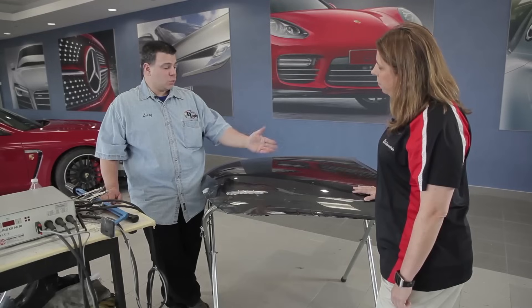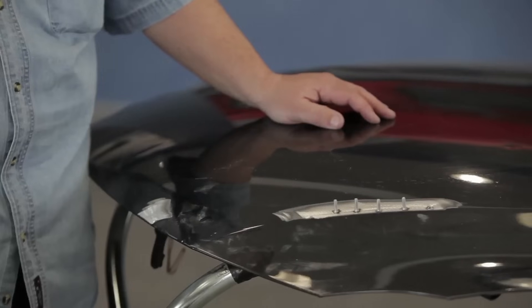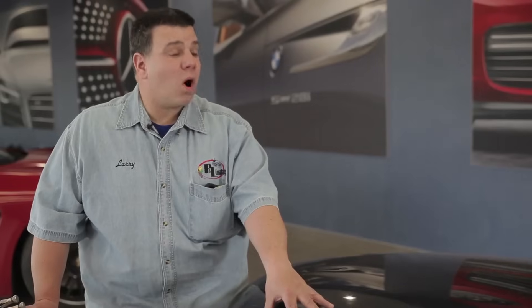There are times I'll drop a ball or put a piece of wood on the panel and hit it with a hammer to duplicate a line dent — and it's surprisingly not that easy to dent in many cases. We'll try to make the dents and show people how to repair them. Some of the stuff we're showing isn't feasible to repair, but we show you the process. Afterwards we check with dye penetrant, and sometimes I'll even try to make cracks by pulling like a slap hammer without heating, just to show why you don't slap hammer dents out of aluminum panels. Let's talk about the dye penetrant process, which technicians and even adjusters who haven't been around a lot of aluminum repairs may not be familiar with.